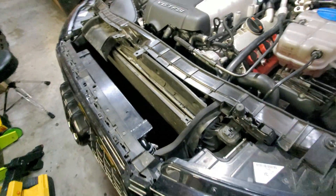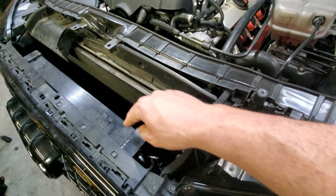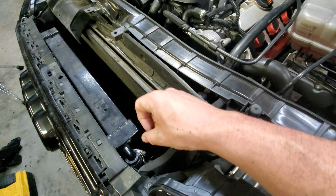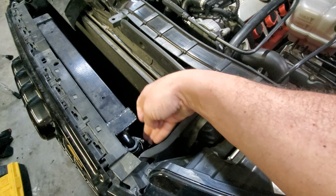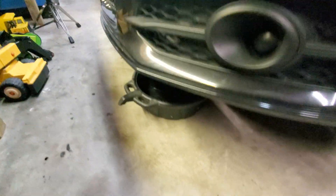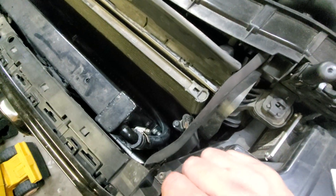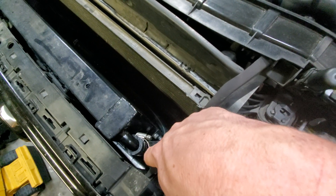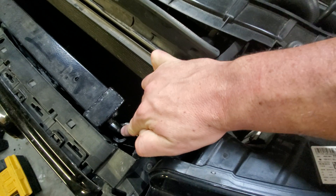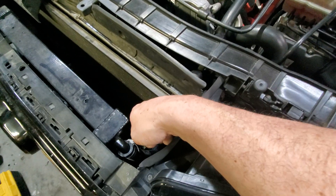As the fluid pushes out and comes up through the heat exchanger, it'll push any remaining air out. With the driver's side up, this side is lower, so all the air gets forced down and out this pipe. As soon as you see liquid start to come out, put the hose back on. I stuffed a rag around the hose to catch spill — also make sure you have a catch pan underneath. No hose clamp is needed to stop fluid since it'll be full to the top. Once fluid comes out, put the hose back on, close the lid to stop the vacuum, tighten everything up, and the heat exchanger is fully bled with no air.